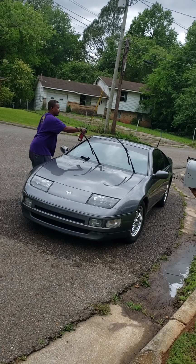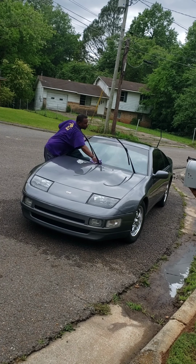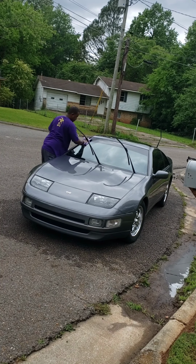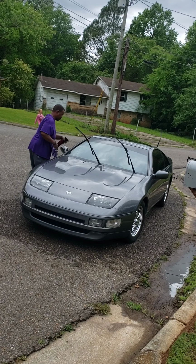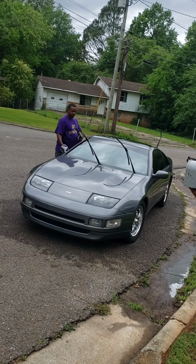A good tip when you are applying your panel wipe is to change out your microfiber towel as it gets saturated, especially if it's a larger vehicle. With this little baby being so small, I was able to get away with using just one microfiber. But eventually it will start to hold the contaminants and then redistribute them back onto the surface. And you can really tell when it's applied to the glass if it's still okay to keep going or if you need to change. If you start to see streaks and residue left on the glass, go ahead and change your microfiber and wipe that area again. Maybe even go back to the previous area and wipe it again just to ensure there's nothing there.